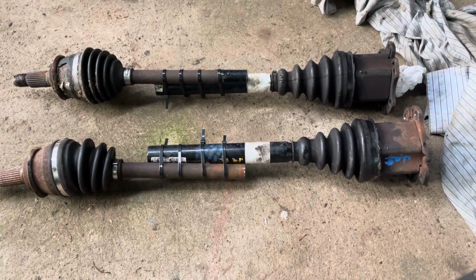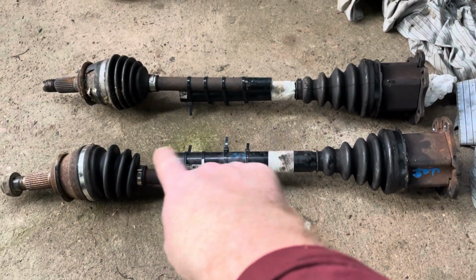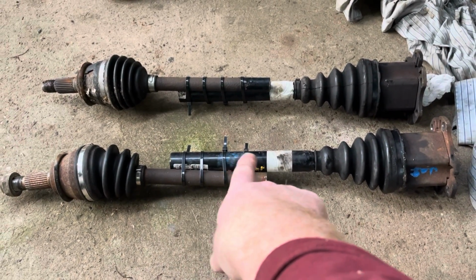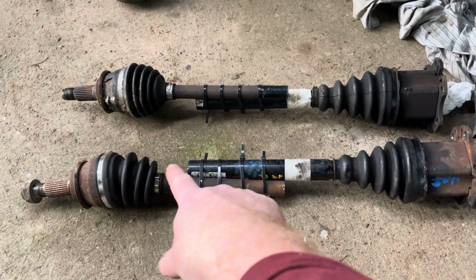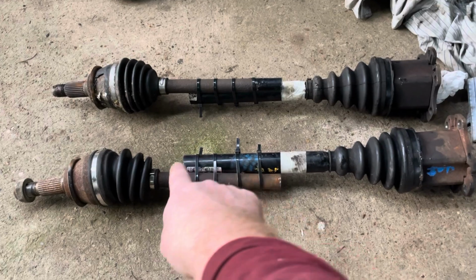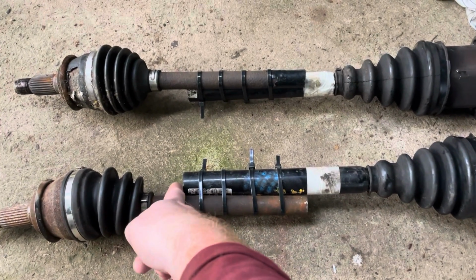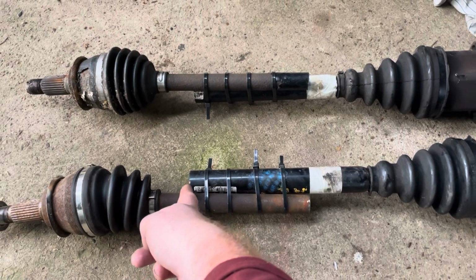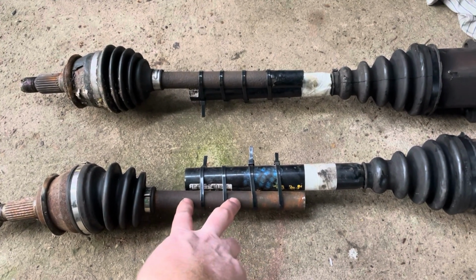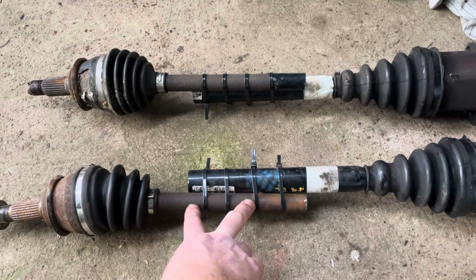Yeah. So basically, I think to start with, I know you talked about the bird mouth, but I think what we should do first is just get both shafts fitted into each other by 2 inches. Then we can decide what we want to do with the end, if you see what I mean. So either just take a skim off this to make it nice and square, yeah, will do. And then what? 2 inches or 3? I think just 2. No, 3. So we do 3 inches.